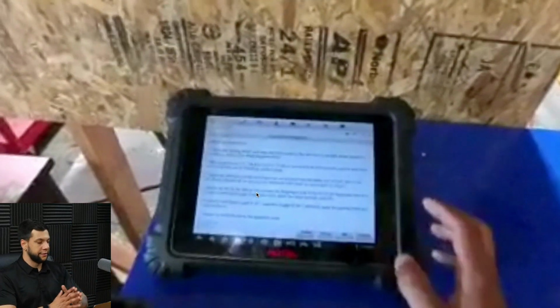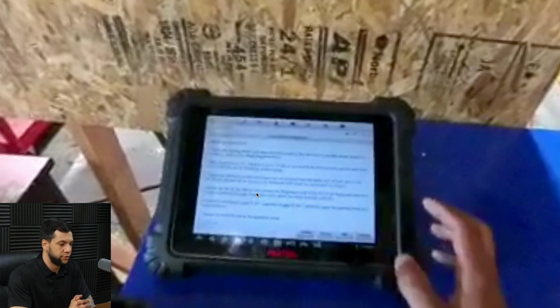And now I just realized, and this is good for you guys to know, that it's not always strict. You can always perform a calibration even though you have a different type of software installed on your tablet. In this case, the measurements and parameters that I have installed in this tablet are for the mobile frame, even though I'm doing the calibration right now with the static frame. So I'm gonna get only the parameters that I need for the range frame, and the calibration will work normally because the distance will still be the same, the height will still be the same, and the targets will still be the same.